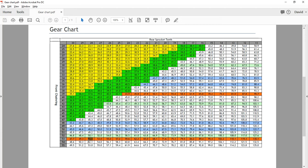The other thing I wanted to cover is that sometimes you get overlaps in your gears. If we look at a standard crankset at 53 and look at some of the gears with a cassette that goes from 28 through to 11 — if we're on the big chain ring at 28, the lowest gear we've got is 51 inches. If we look at 39, the gear ratios on that chain ring start at 37 and go up to 95 inches on the 11 sprocket. There's actually quite a bit of overlap in those gears.